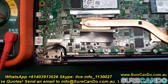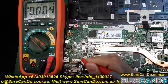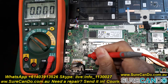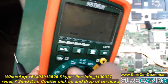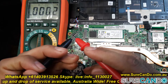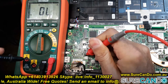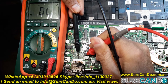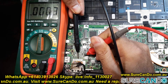Now I'm going to do it in continuity mode and show you that pin number 13 actually links to the lid closing on/off switch diode. I'll put it in continuity mode — you can see zero ohms, so that's continuity with zero resistance. And there we go, you can see that's a continuity there.